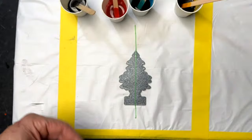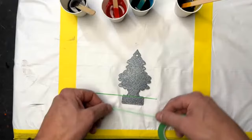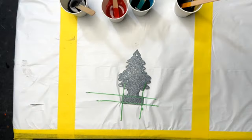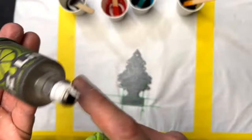I'm going to change my mind on that — I'll pull that because I really just probably want to edge around this first. What setup do you use to make sure you don't get moisture in your air for paint? We do live in Utah so it's a pretty dry state. But you're going to want some kind of a filter trap on your compressor, and then definitely something to hook onto the bottom of your paint gun, or a disposable ball filter. This one does have a release valve, so it's reusable.